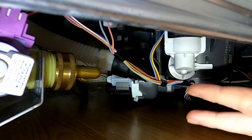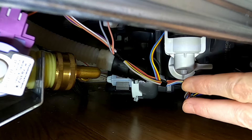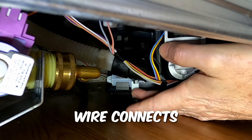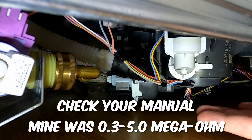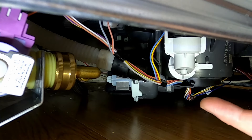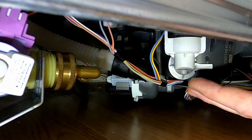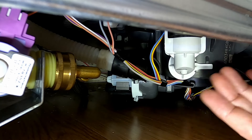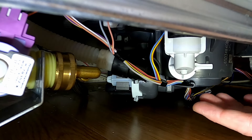When you have the pump out from underneath, you'll see where it connects. Use a multimeter set to ohms — put one end on each of the metal pieces inside where the connector attaches to the pump and read your ohm setting. If it's within specs, you're fine. On mine it was jumping between three different numbers, and then I hit it on the ground — unintentionally, it slipped — and after that it started reading correctly.